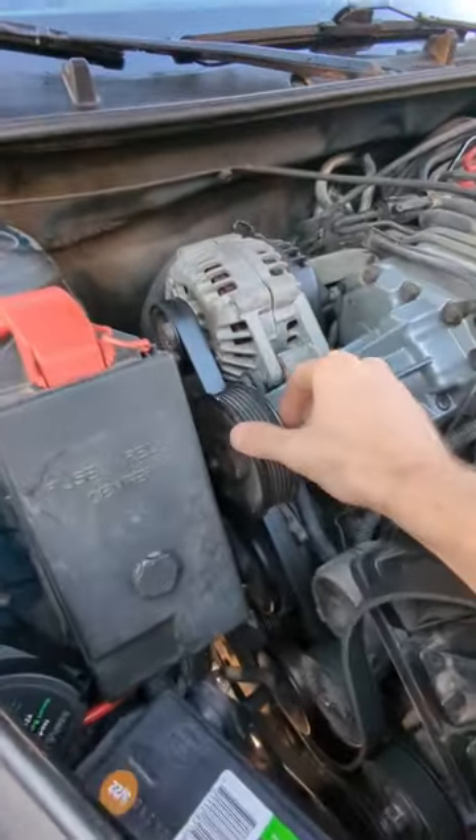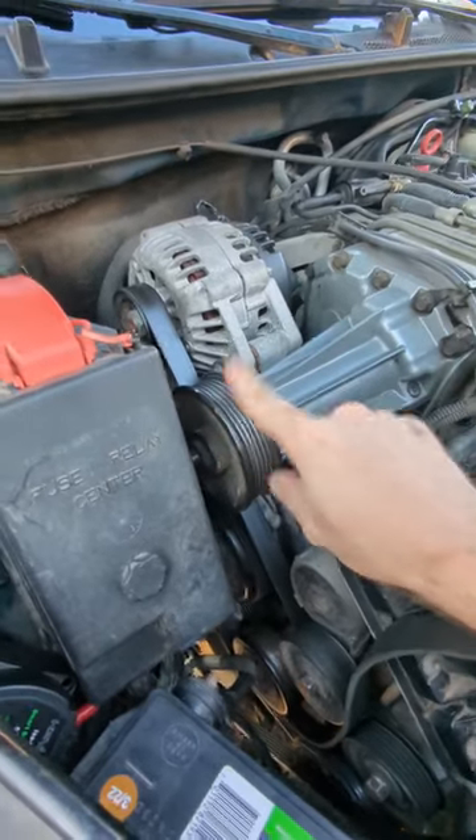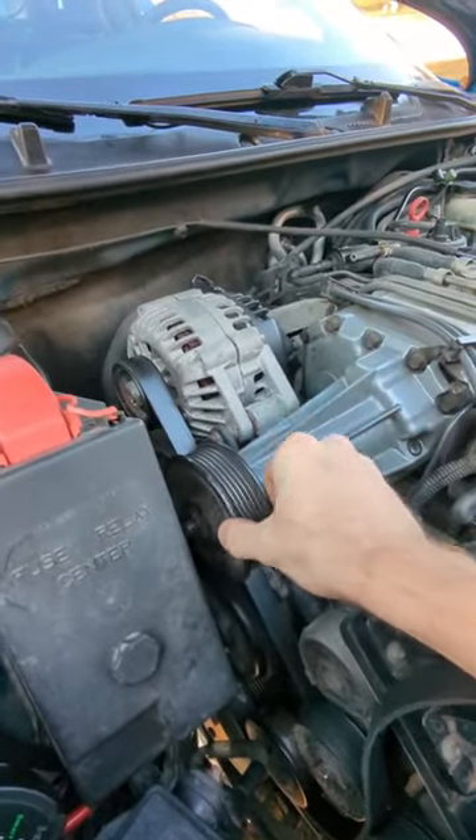No. I took my belt off my supercharger — listen to this. This is loose. So I need to take the nose off the supercharger, come in here, replace the coupler, and then put everything back together so that this slides smoothly.